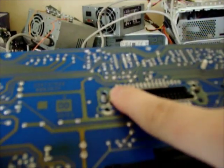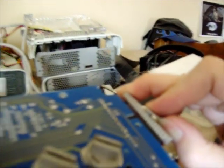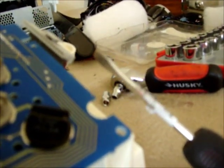Figured it out. You got 2 really small screws here, like a 4 millimeter or 5 or something. And then you got 2 T10 Torx bits in these holes here. And then you gotta take these little ribbon cables off. And to do that, you just lift up on this tab here, and it just slides back. I mean, you could take a little screwdriver and kind of just pry it back ever so easily. So, let's see if I can't do this one-handed. Let's see what I mean.